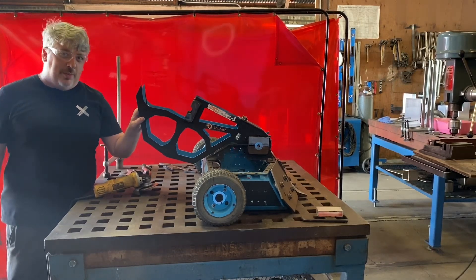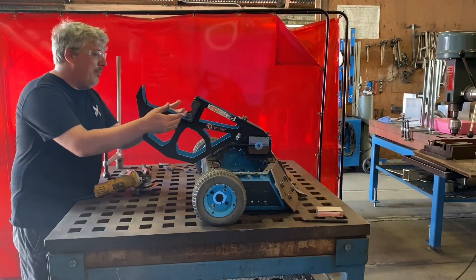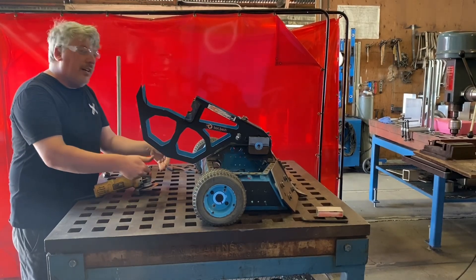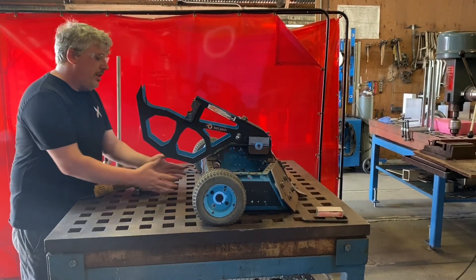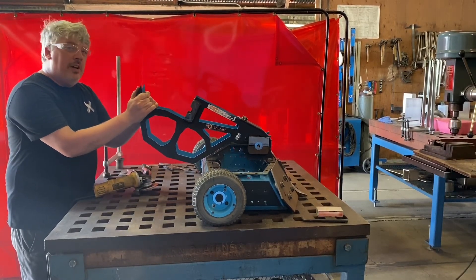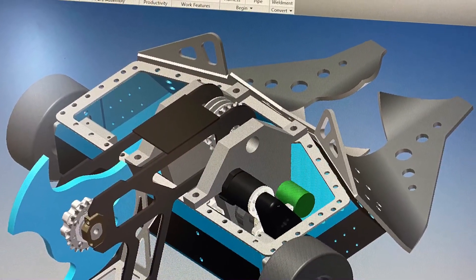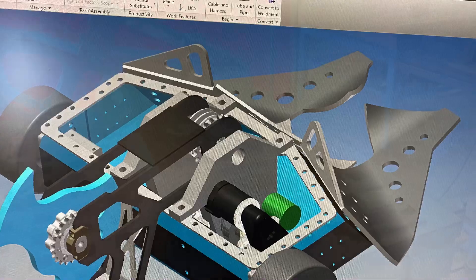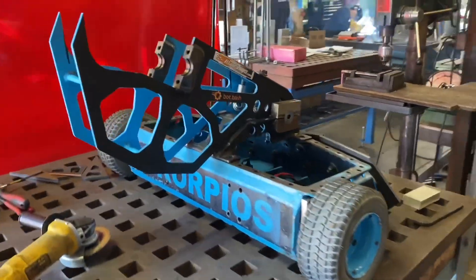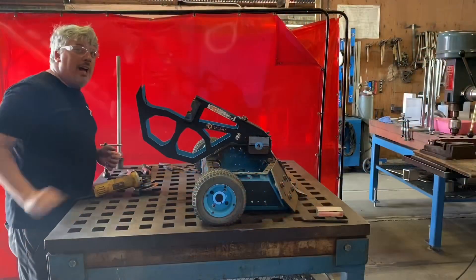DoverBlog, you've been telling me for years to put a wheelie bar on it, so now we're finally going to do it. We're going to take our turtle shell arm, cut it here and here, and weld this chunk down here to turn it into a wheelie bar. Unfortunately, the nice one you saw in an earlier episode will not be here in time for the fall face-off, so we are going to make one out of the parts we have laying around.